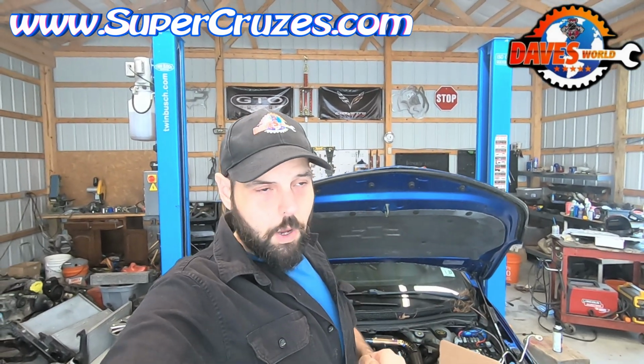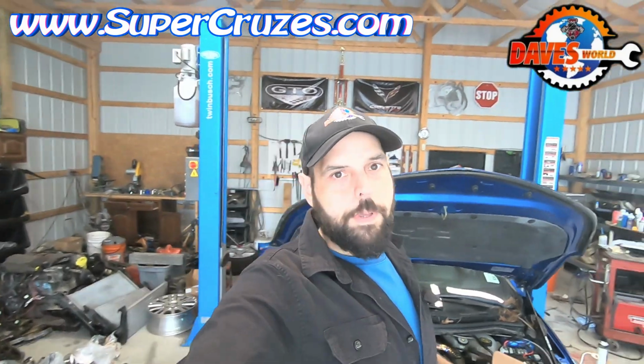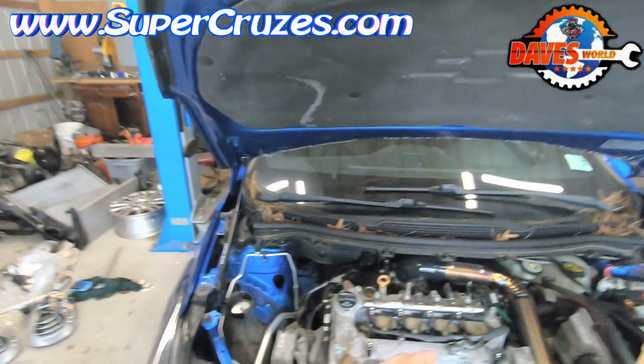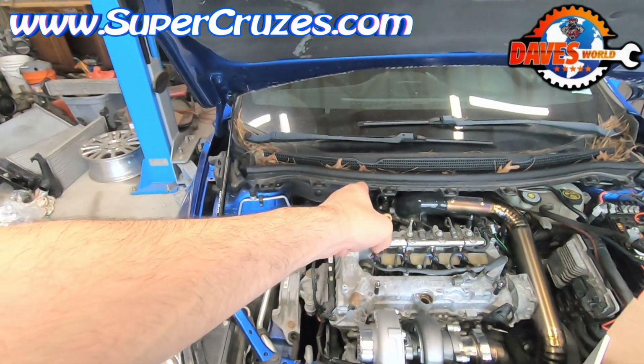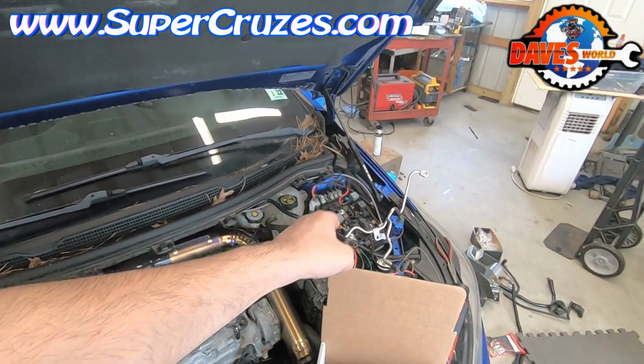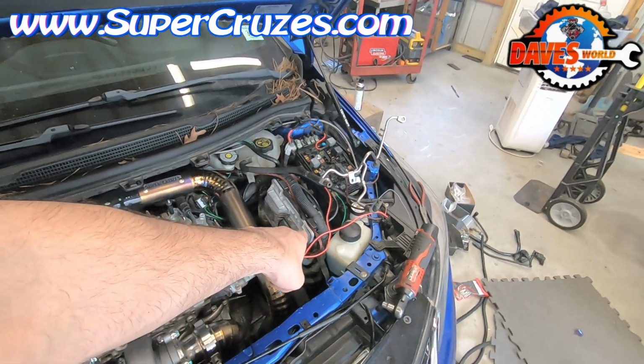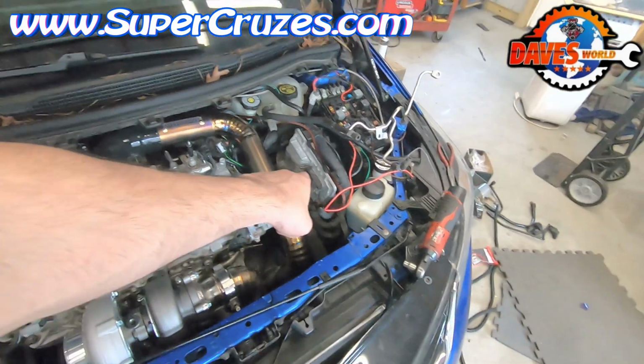If it shows 0, that means flex fuel is active, but the signal might not be coming in, and the ways that the signal might not be coming in could be that you didn't plug the harness in, that your vehicle does not have 12 volts at that fuse, or when you pushed the pin into the ECM, it's not in all the way. So it's important to verify your connections.